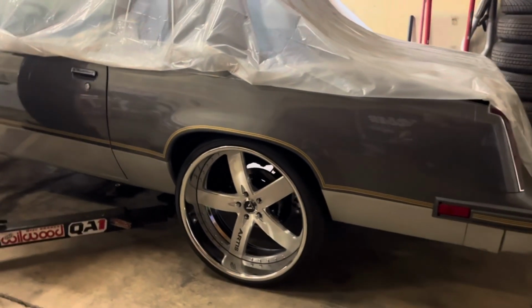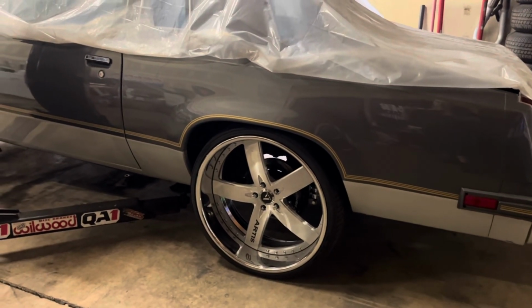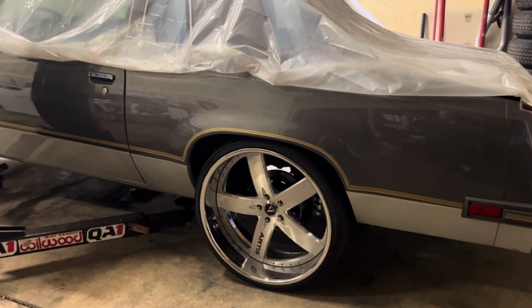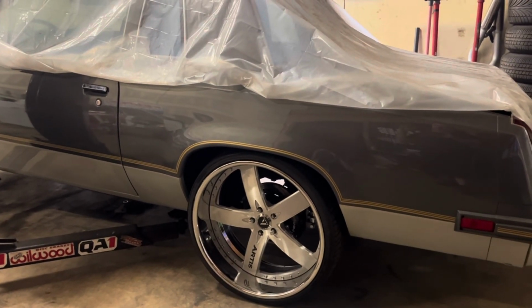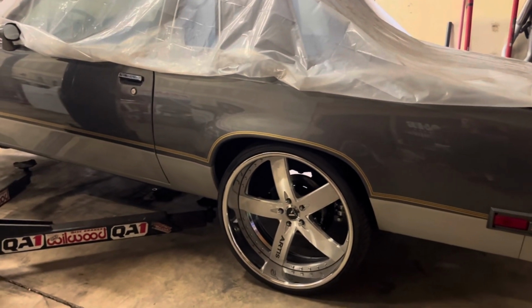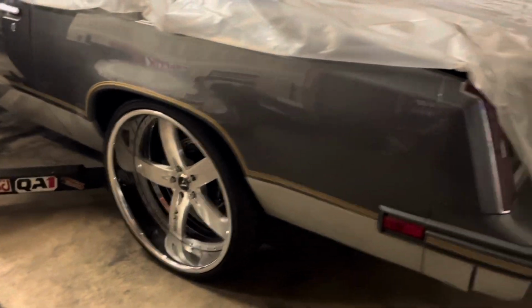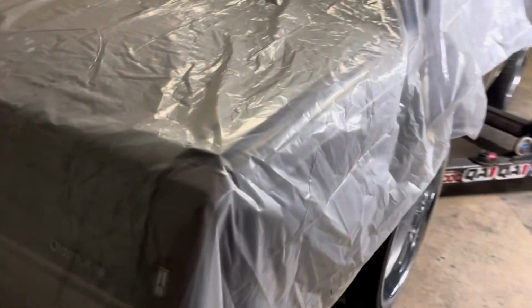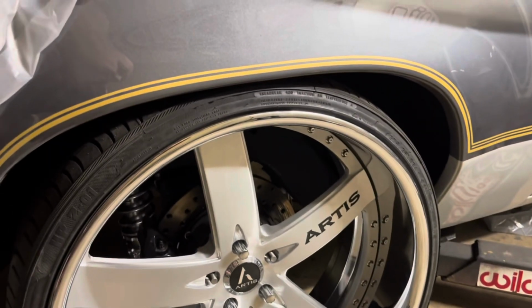This car, every time I measured it up in the air, rear end level, made the car the same height. There was an inch, half-inch difference. I couldn't figure out why. So this side of the car on the back is half an inch higher. Now if we go over here, the springs aren't totally set yet, but this is before putting all the springs and everything in it. You see the heights over here.